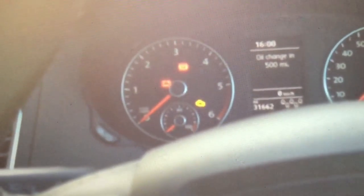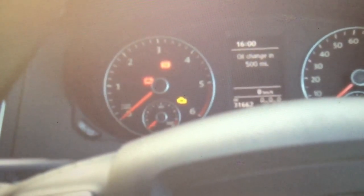So if you've been the unfortunate one and you've been ignoring your AdBlue messages — the countdown's gone down, the bottle's gone red, the car won't start — the emergency start procedure, which will only give you an extra 35 miles: you put the ignition on, you leave it for 30 seconds, and then you will get an extra 35 miles popping up on the screen.